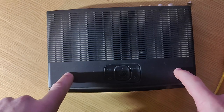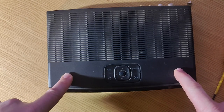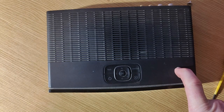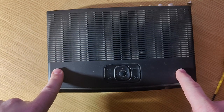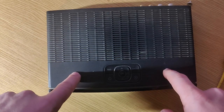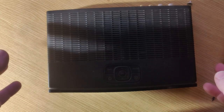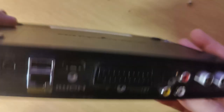These are really easy. If the box is not starting up, it's stuck at the startup screen, or it's making horrible clicking hard drive noises, all you're going to need to do is remove about 10 screws and get a replacement hard drive. They generally support up to a terabyte and use a 2.5-inch video hard drive, much like you get in a laptop.